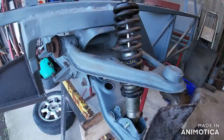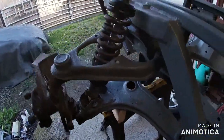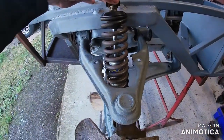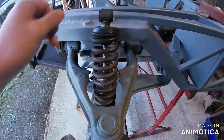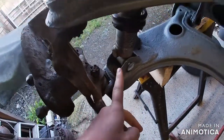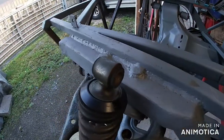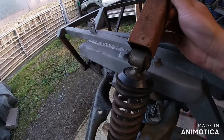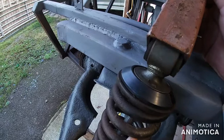So that's where the shock's going to sit, which is not bolted in fully obviously. So that's how it'll sit — if you're looking down, this will obviously be in the middle of the top arm, like that. And it's just on the standard mount down here where the bottom of the old strut used to go. And for the top here, I'm going to be using a piece of this box section because it fits quite nicely onto there.